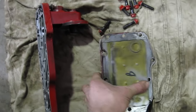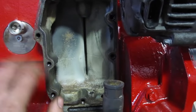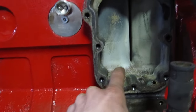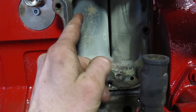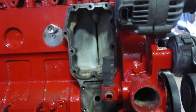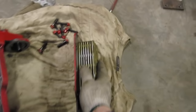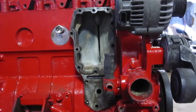Less wear on the engine if everything is very consistent. Your oil pressure runs up to about 70 psi — 20 at idle — whereas your coolant pressure runs up to about 14 psi. So while running, if you've got a leak in your cooler, oil pressure is pushing oil into your antifreeze. When you shut the truck off, oil pressure stops, but the system is still under pressure, so you can get water in your oil. If you do an oil change and see water in there, it might not be a head gasket — it could be an oil cooler. This is also very common if you've had freezing, because there are very thin gaps in there. The water freezes and wrecks these coolers. So pull your cooler before you diagnose the head gasket.